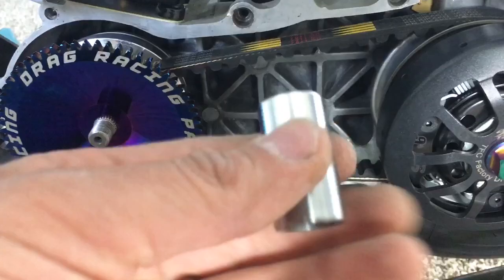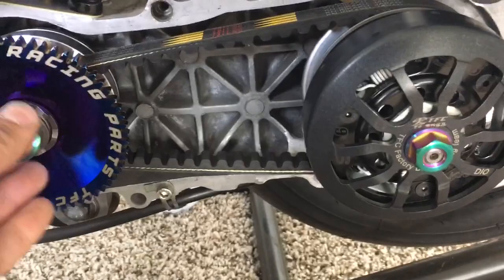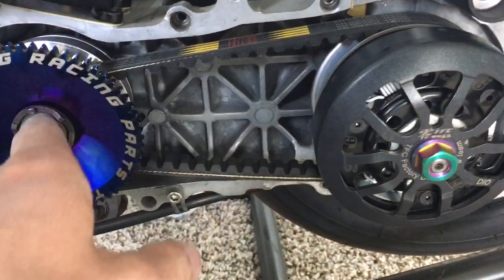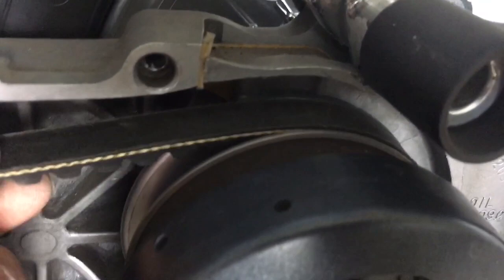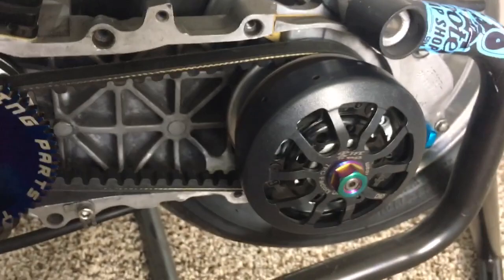Your boss and shimming is huge. If you've got bogging on your bottom end — if it bogs for a long time and then takes off — your issue is your shimming. You want this belt to be way up here. When it's idling, then you're probably fine — it's about perfect fitment. That's what I would like to see on my bikes.